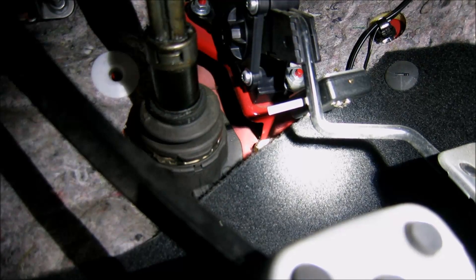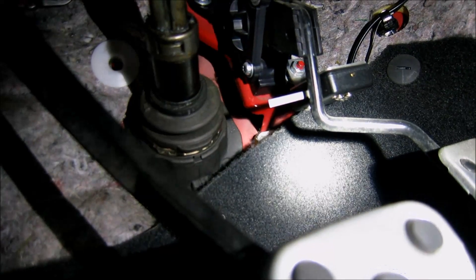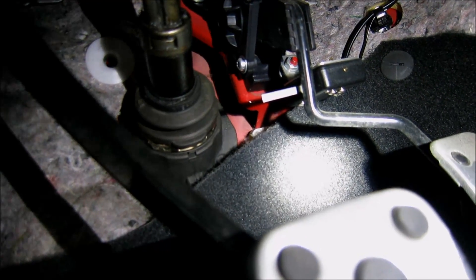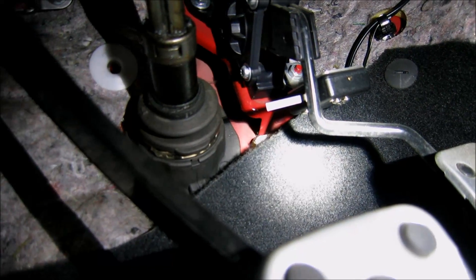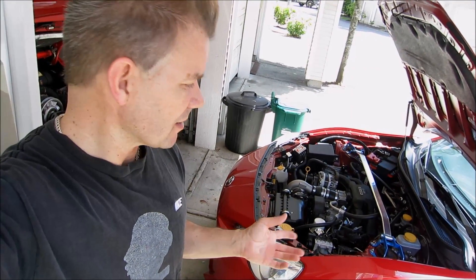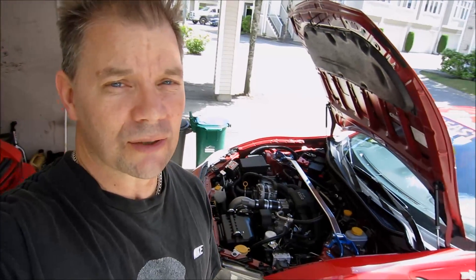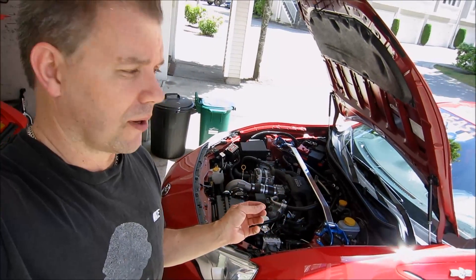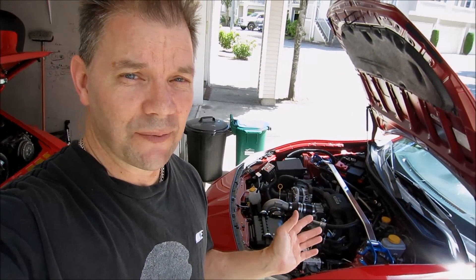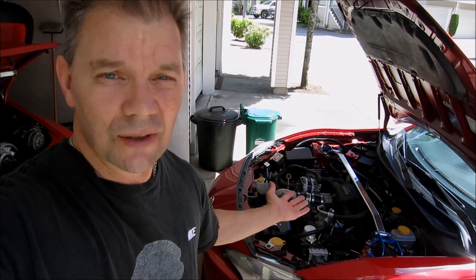It's recommended that you have the first stage come on at at least 75% throttle, if not higher, and perhaps the second stage comes on at 98% or almost full throttle. I have this right now at a much lower point and it's causing some problems. Right now the mechanical position switch is probably activating the first stage around 60% throttle opening, which works some of the time, but sometimes it can actually cause a situation where the motor will almost stall. For example, when you blip the throttle as you're getting going, you can sometimes go over 65%, which activates the electric supercharger and can almost cause the engine to stall, which could be dangerous.